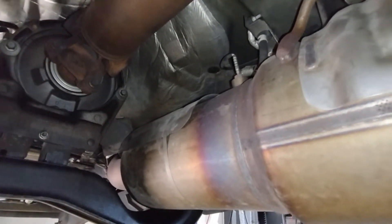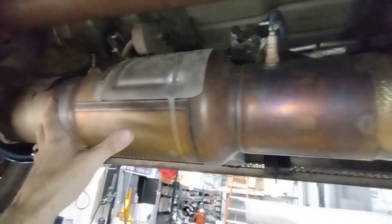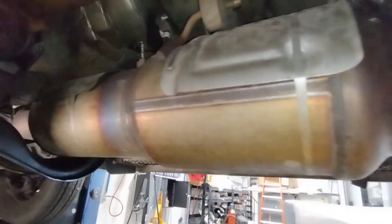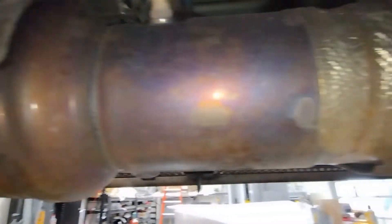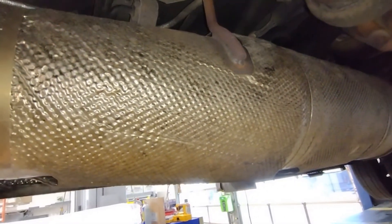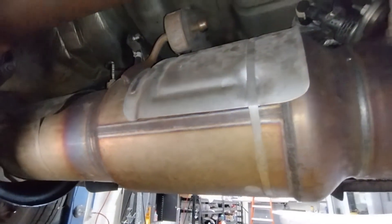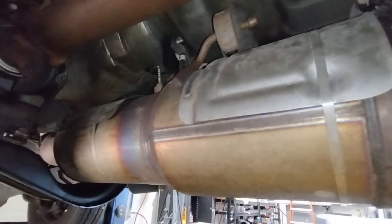The upper and lower exhaust downpipes deliver exhaust gas from the turbo to the catalyst and particulate filter assembly. The catalytic converter is a ceramic catalytic converter which oxidizes hydrocarbons and generates heat for the DPF to do a regeneration. The DPF filter is silicon carbide wall flow.